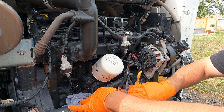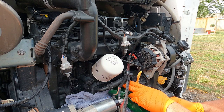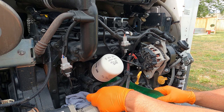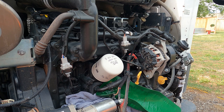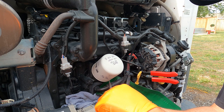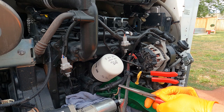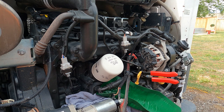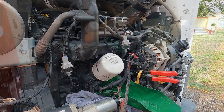I'm laying a towel down in here to catch any coolant I'm about to spill, because you're going to spill a little bit. I'm always in the field and never have access to water, so what I've got here is a Forma funnel. This is the oil cooler assembly right here underneath our oil filter. We're going to pinch off this hose right back here, get that nice and tight, then move the clamp out of the way and remove this hose and connect our 5/8" hose so we can pour the coolant down into our drain pan.